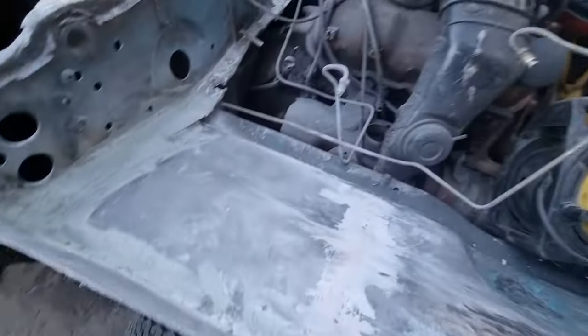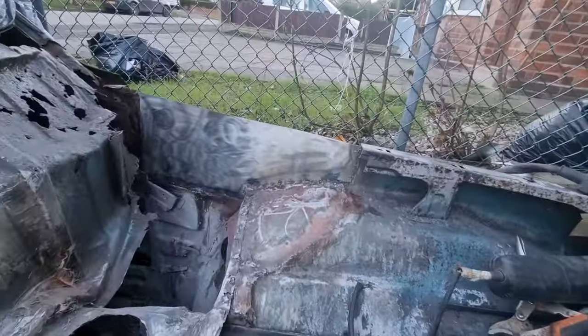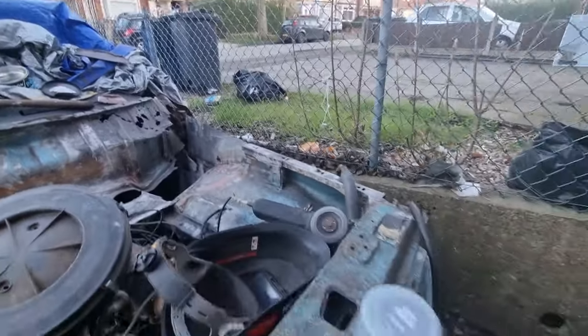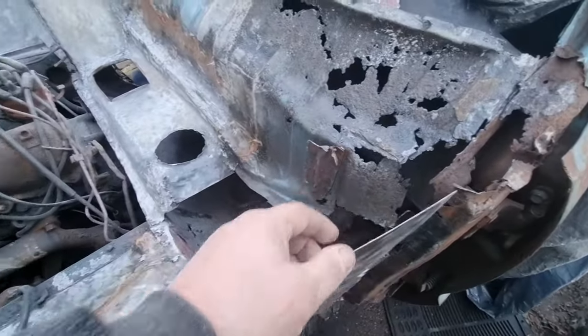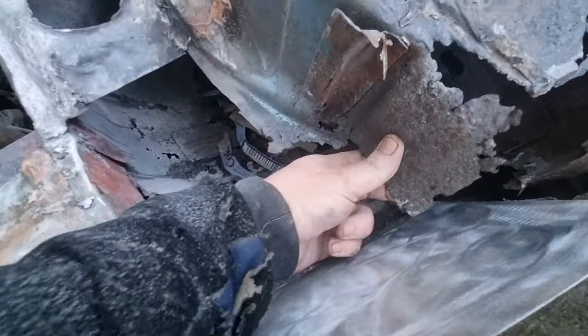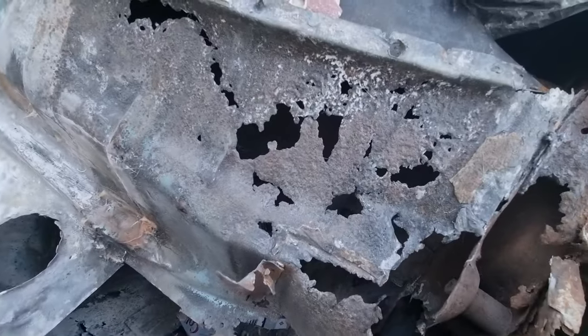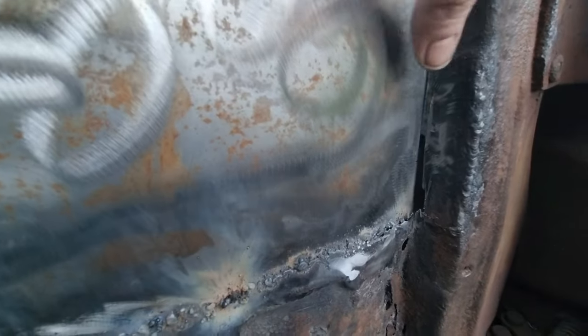Seam sealed. Bit of fiberglass filler, seam sealed. I've started redoing all the work over there because I wasn't happy with it. I was going to put this back on the top rail but then I thought it gives me the perfect space to work and start getting all this filled in. I'm going to complete this side first and repair that. I've got all that welded in now, just got to grind it. I've got a place for this lip — when I remake it on this post it'll run over the top of this, same as the other side.